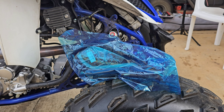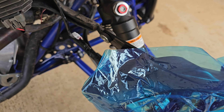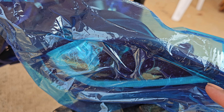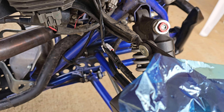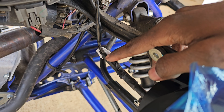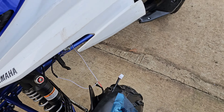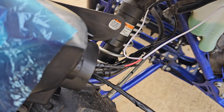In order to wire up your daytime running lights, there's gonna be a red wire if you want white, and a yellow wire if you want amber. Take the supplied white wire that comes with the headlight and connect it to the red wire, then run it to the opposite side to the next headlight and connect it to the red daytime running light wire on that side.